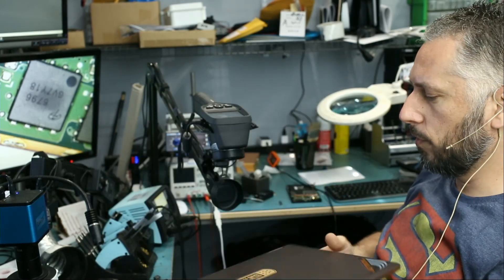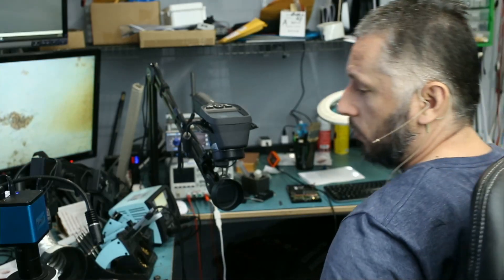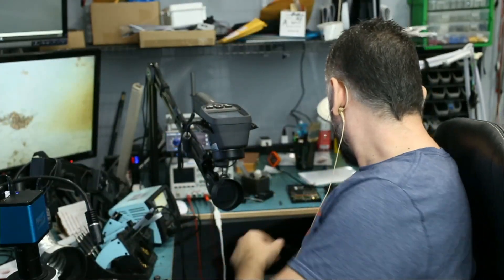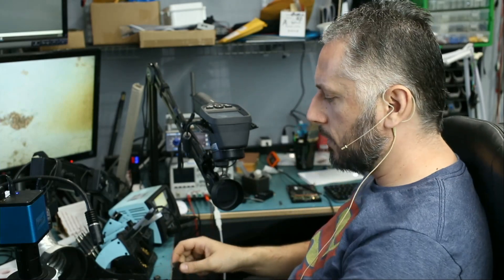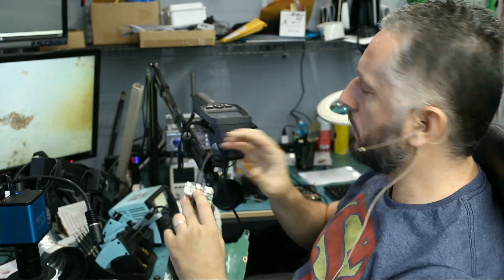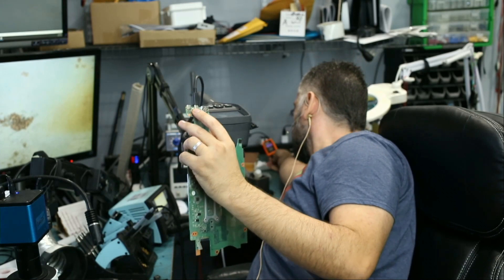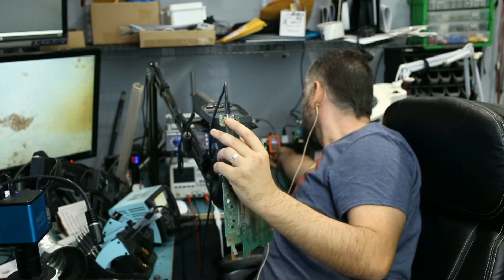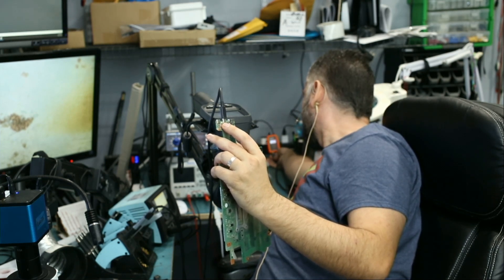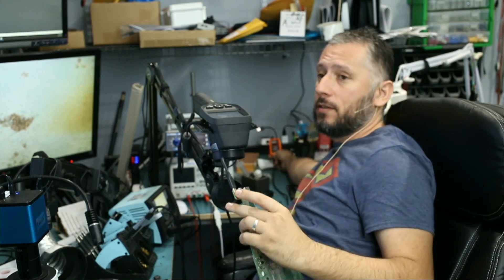Here's the motherboard for the laptop. I'm going to plug the USB-C charging cable onto the side — when we plug it in, the LED should light up. If I plug our USB-C cable, we do not get a light. Looking at the amp meter, it shows 5.14 volts at zero amp draw, so nothing is being drawn. If we plug the USB-C cable into the second port, the amp meter does not even light up.